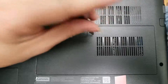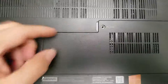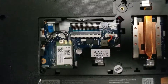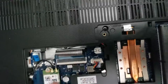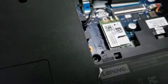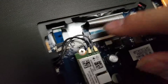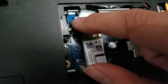Under here, if you want to change the RAM or the wireless card — if it's having issues or you need to replace it. This one had a wireless card issue earlier. There's the keyboard connector here — if you have to replace the keyboard, the connector's right here. There's a latch that you have to lift up before you take this off.